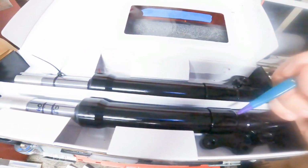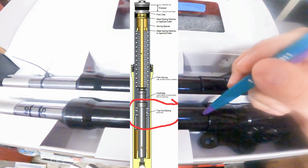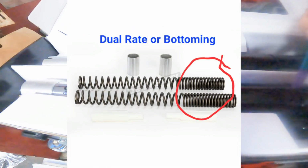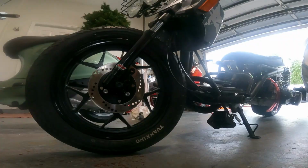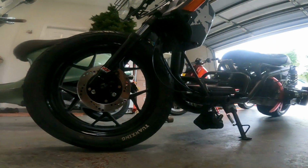You'll also hear me talk about topping springs and bottoming springs. Pay no mind to that for this video. We'll get into that in the next video. These have topping springs in them. They're basically so when you take off real fast and the forks unload, and this part comes up higher, it doesn't make a metal clunking sound in here. As far as bottoming springs, I was trying something with valve springs to put in there to make the bottom spring rate slower. I'm going to check something called sag, or race sag, or rider sag.